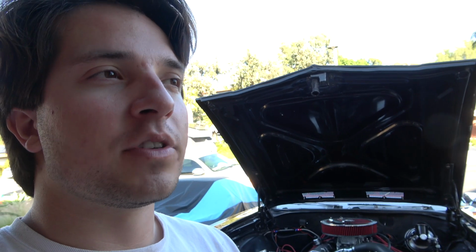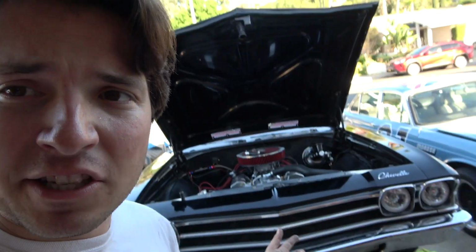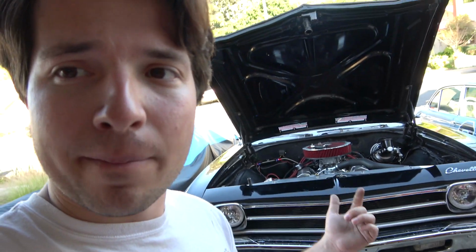And I think the problem was, I think it bottomed out because I didn't have a washer on it. And it kind of broke the bolt, the starter bolt, inside of the block. So that's not good. So we had to pull the header off again. As you can see, we had to pull the header off again. And basically, Lenny's drilling a hole right now into that bolt. And then I'm going to use a bolt extractor and try to get that bolt out.